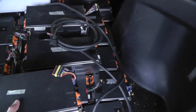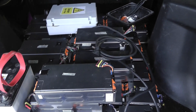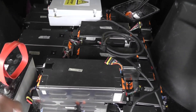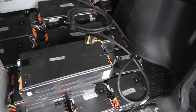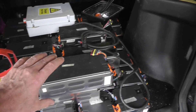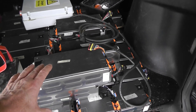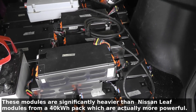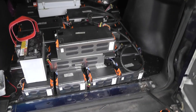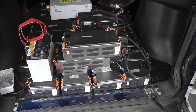There are so many batteries that came with this e-Golf, or rather the batteries are so large. I wondered how Volkswagen managed to use these cells without any cooling or heating and without any overheating issues. I've come to the conclusion that these cells are so over-specified for current that they just don't get hot. And the reason they don't get hot is because they're big — big heavy things.